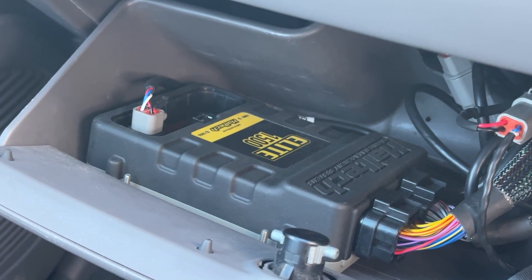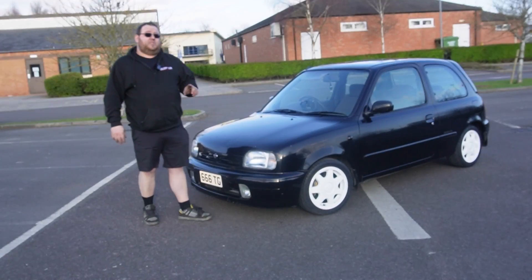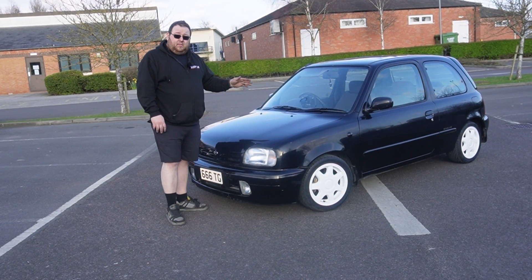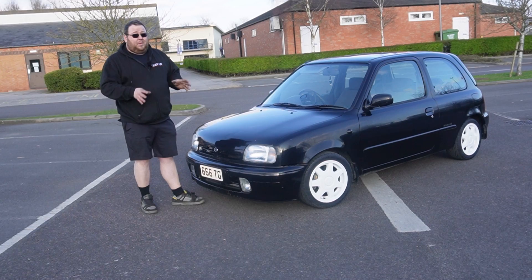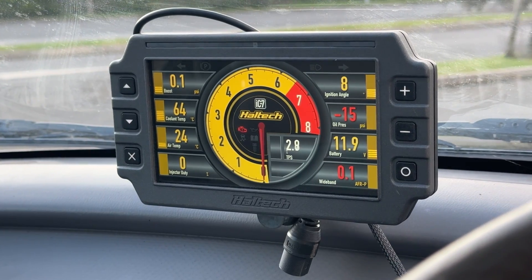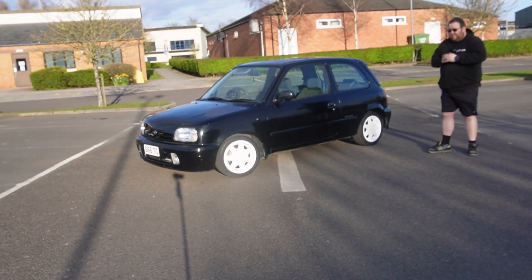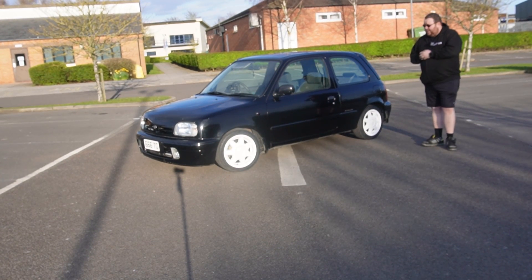Fortunately for this model with the distributor ignition, Haltech do offer a plug and play solution for it — with the exception of two wires to wire in the external air intake temperature sensor. By all means, the ECU is a plug and play affair. To complement the Haltech Elite 1500, we also have the Haltech IC7 dash, just to keep an eye on the vitals when the car is in operation. All in all, that makes for a pretty impressive package for an old Micra. Let's start walking on — let's go for a drive.